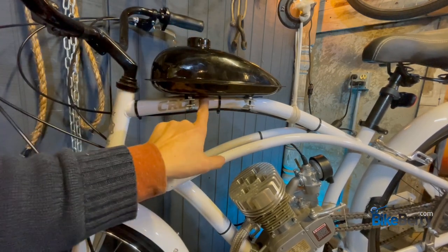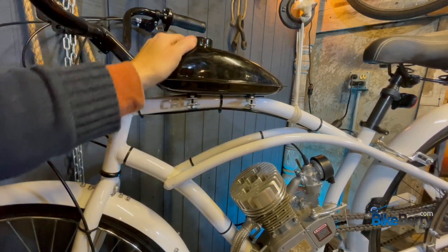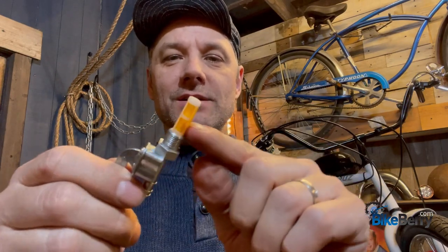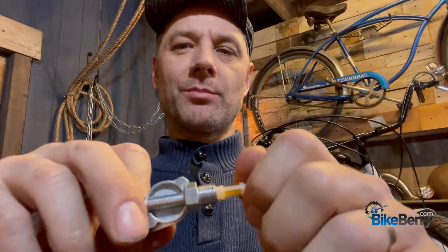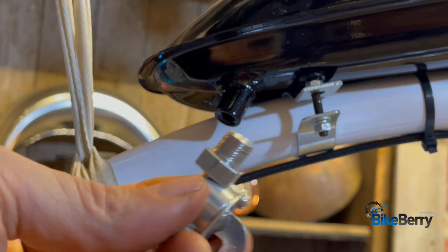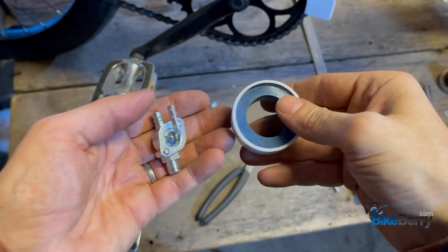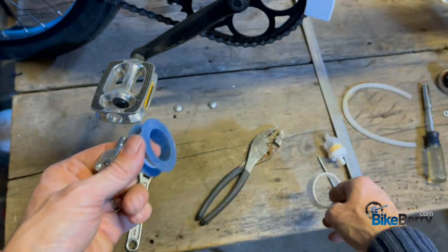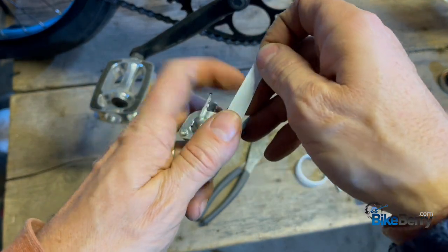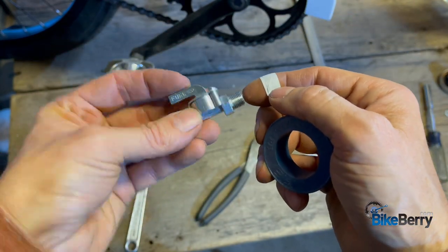You could add silicone or double-stick tape for a more solid mount, but I'd trust this. Next we're going to install our fuel shutoff valve. This filter screen that goes up in the tank is too fine and clogs up quickly, so just get rid of it. I believe these threads are tapered, so as you thread it in it gets tighter against the walls for a better seal. To ensure a good seal, we're going to use thread tape — like plumber's tape, available where they sell air compressor fittings.